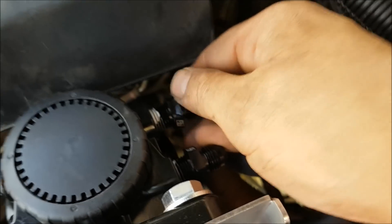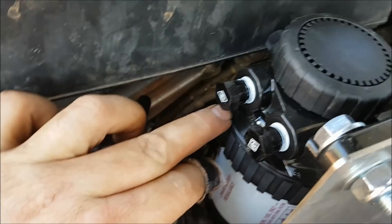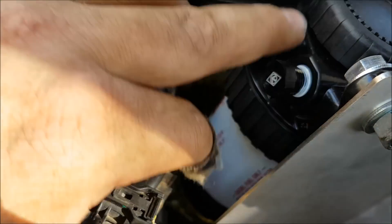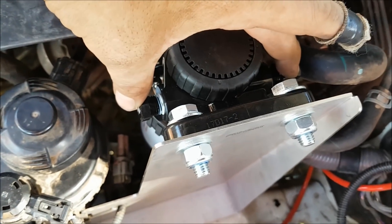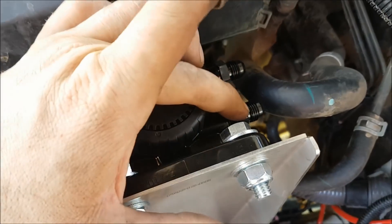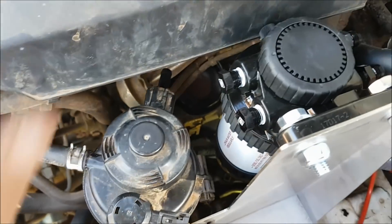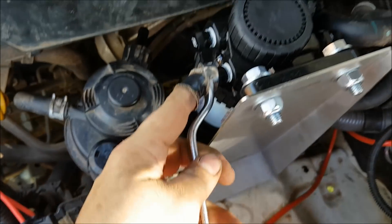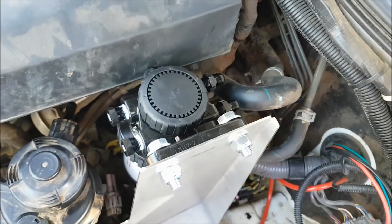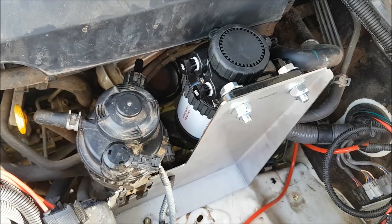Both sides are marked the same. Underneath you'll see an arrow — this one points out and this one points in. The two at the front end are the intakes and the two at the back are the outlets. So fuel goes in from the fuel tank on the back here, and then out from here to the existing factory fuel filter. The fittings are 5/8 and 11/16 — they use imperial fittings, like gas fittings. They are a tapered thread and aluminium, so just be gentle on them.